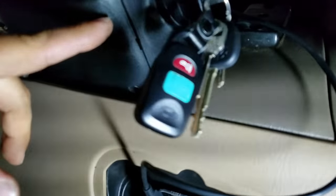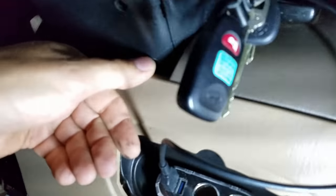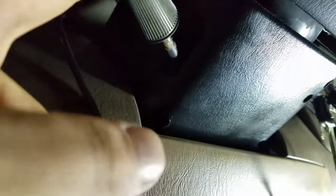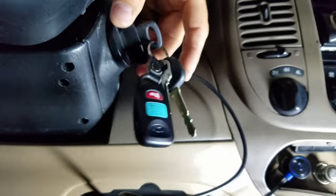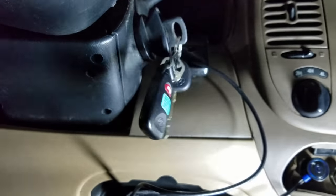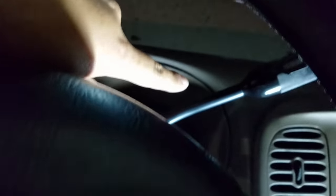You've got a Phillips screw here, a Phillips screw back there, and another one just behind your tilt. It helps if you tilt the wheel up so you can get full access. Those are Phillips screws under there. The ignition lock is probably the first thing you need to take out to do any work on the multi-function switch, to change out the lock cylinder itself, or if you've got one of these bad shifter knobs where the overdrive button gets stuck or doesn't operate properly.